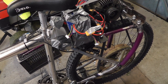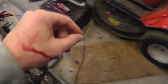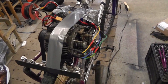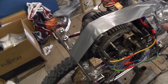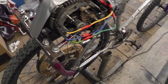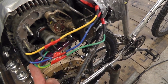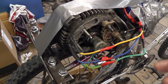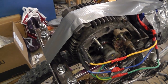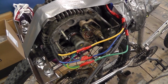A couple of things that might be of interest. Firstly, this is the original motor I started out with at the beginning of this series. I couldn't figure out how to wire it in delta and make it work, but now I have got it working. There are three coils coming out here and three coils coming out here. This coil and that one are linked, the two middle ones are linked, and the two outside ones are linked — that's linked internally in the alternator, or what is now a motor.